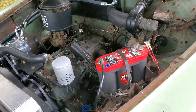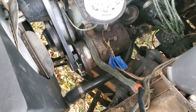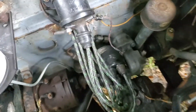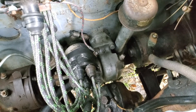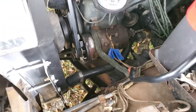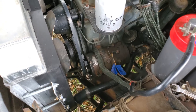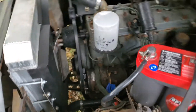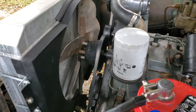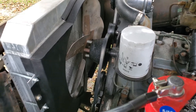I knew if it worked on real 6 volts, it would certainly work with the car running. I had to stick with the generator because on these Nash cars the generator has a shaft out the back that runs the water pump behind the distributor, so you have to stick with the factory setup. On any other car you could easily get a 6-volt alternator. I don't have an electric fan — I just built a shroud and got a six-blade fan — to keep things simple and avoid loading the electrical system.